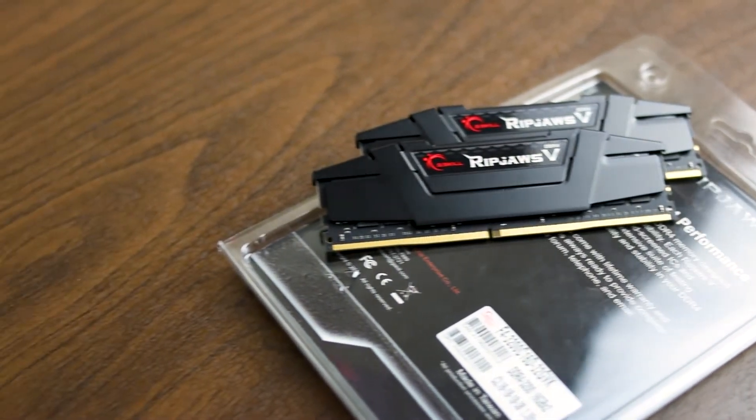The next most important thing to me was the RAM. I knew I wanted 32 gigs with the option of upgrading to 64 in the future, which the ASRock motherboard does provide. I was able to find 32 gigs of Ripjaw memory on sale for $145. This memory also has a speed of 3200, which is great for a Ryzen build because Ryzen really likes fast RAM.